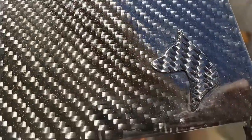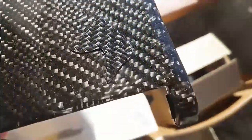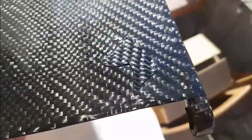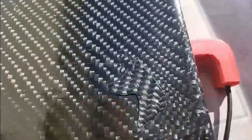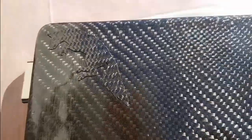Here you can see what I mean by the sanding scratch marks. What I need to do is sand this with progressively smoother sandpaper, maybe all the way up to 1000 or 2000 grit, and then apply the lacquer. But for now my hands are too tired. At the bottom left you can see how the fibers are disturbed — maybe I'll cut another animal carbon fiber shape to cover it. And check this out — in the sun it looks amazing even with the scratches.